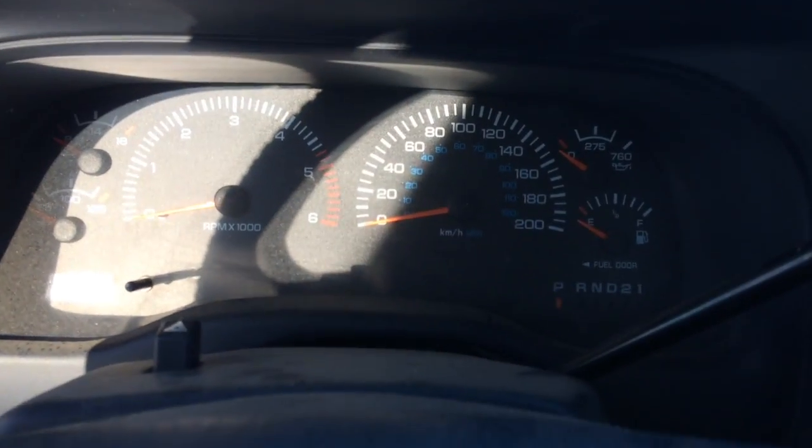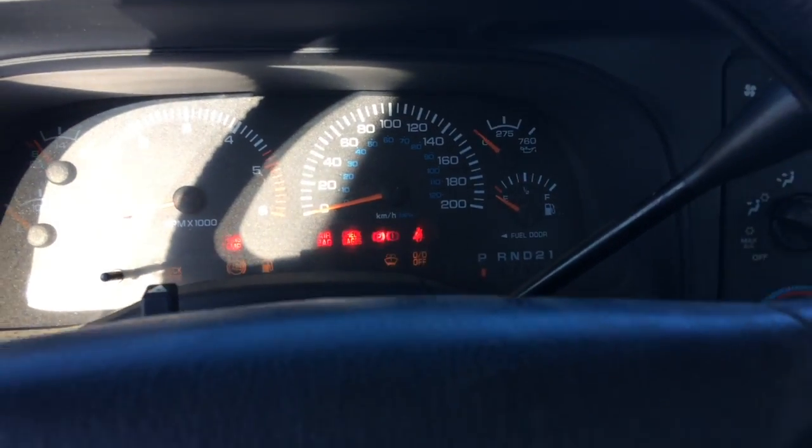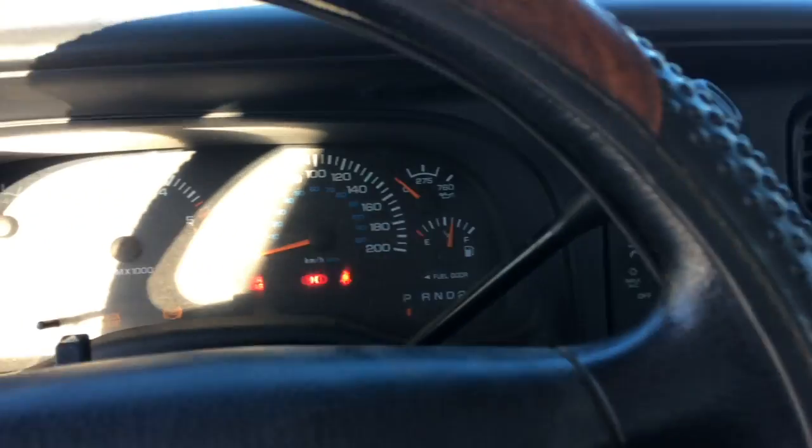You're going to want to try and find something that's maybe 200,000 kilometers or 140,000 miles. But I wouldn't go any more than that because you're going to be looking into a possibility of a valve job or a complete engine overhaul. You don't want any part of that. Usually, if you can go to an auto wreckers and find yourself a scrap vehicle that's been in a minor fender bender, but the insurance company wrote it off, chances are the vehicle might only have 50,000 miles, but the engine and transmission are still good. So, anyway, moving on, you're going to want to make sure that everything works, except all that. We don't care about that.